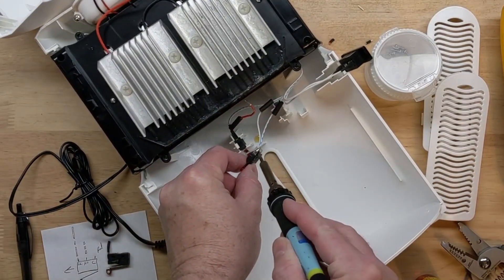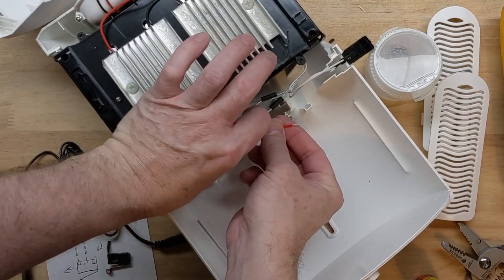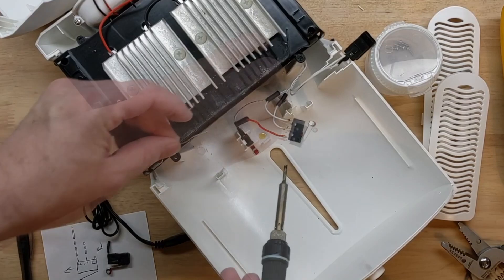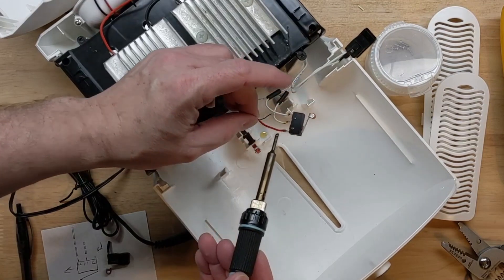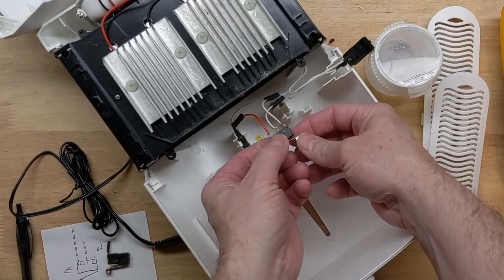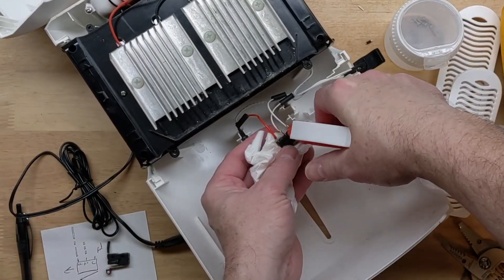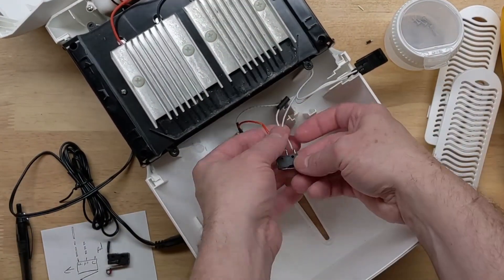That's why I mentioned we might want to utilize the power on/off switch more. When it gets full and we grab the bucket, slide it right back in — that make-and-break of current flow is only happening across these little micro switches. With these being sub-miniature micro switches, they're not going to handle that for a long period of time. When we're taking the bucket in and out, we can cut the main power off while doing so and flip it back on. That will probably save a lot on these little sub-miniature switches.